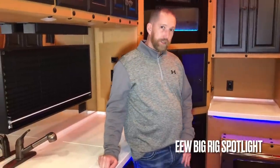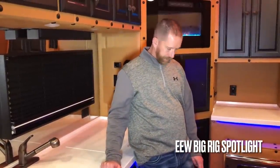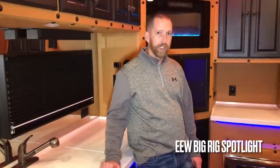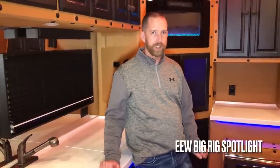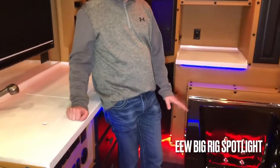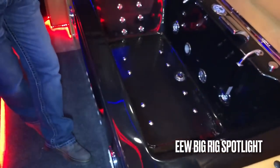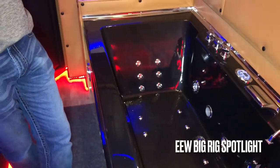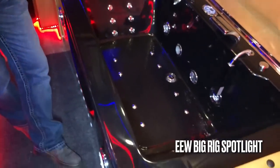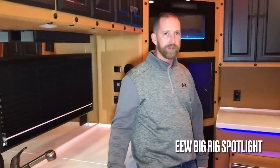And by this being a tub, this is a free drain. This can run right out onto the... Correct. That's the way it is hooked up, to just drain out on the ground when he's done. It just goes straight to the ground. Kind of a concern we had with this is it does have a heater, but it's not enough to heat cold water. It's actually a maintainer. It maintains the temperature once it's at that. So that's why we had to go with a different water heater.